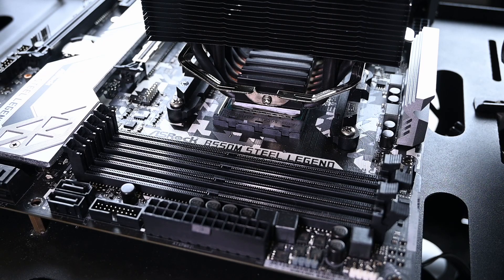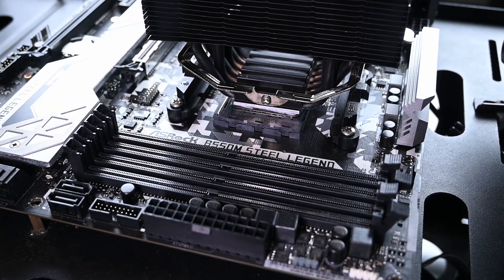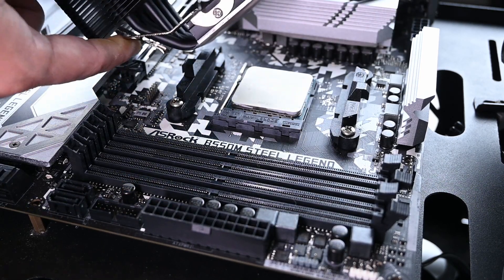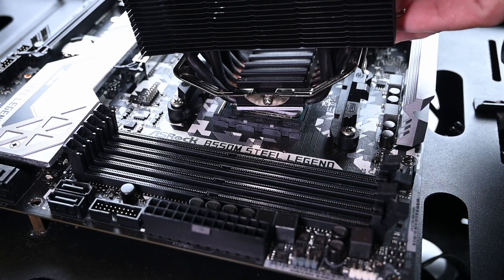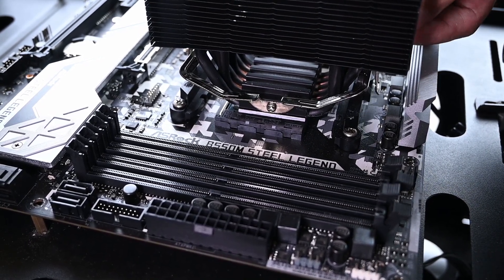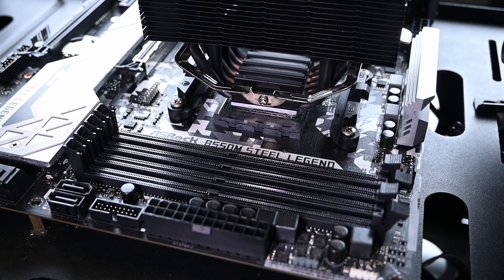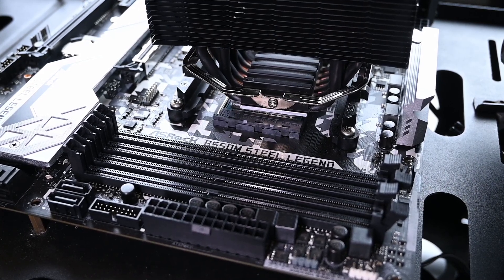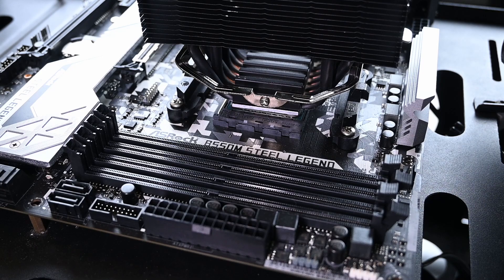However, the Outsize cooler, which I reviewed and gave a negative verdict, is actually worse than I thought. I had used this on my gaming rig and never thought of this issue until I tried to remove it the other day. This kind of clip requires you to apply pressure to hook — notice how it hovers like this — meaning you have to apply pressure and then even more pressure to clip it. When you remove one side of the clip it will spring, and if the thermal base is creating suction, that's what happened to me — my processor came out.